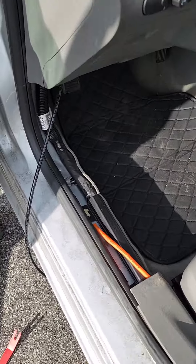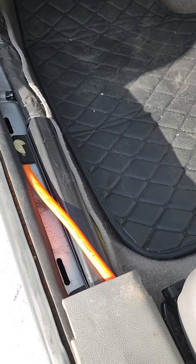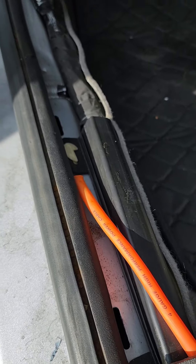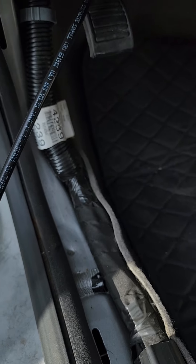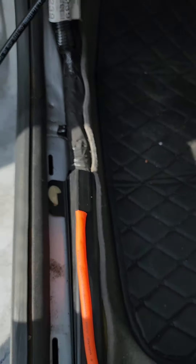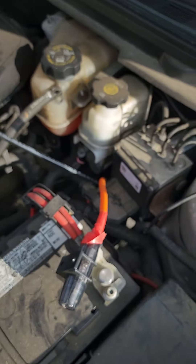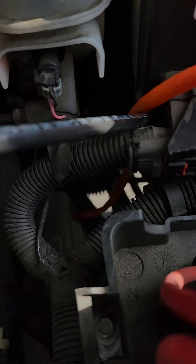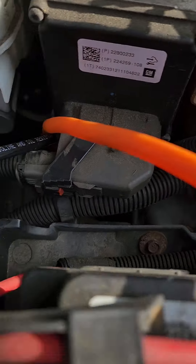I decided to replace my power wire. It's a 4 gauge CCA — basically it's junk. So I decided to replace it with some pure copper 4 gauge, 9 strand or 19 strand. I already put it up through the firewall under here. You can see that. I cut this wire here so I can just pull it out. Because this is real copper, I just straightened the wire and it pushed right down through there before I even pulled out the old power wire. So it was easy.